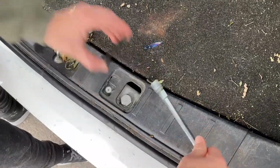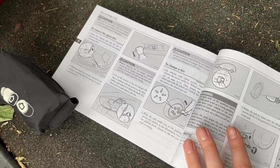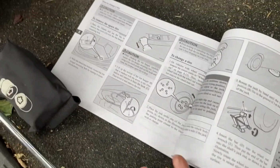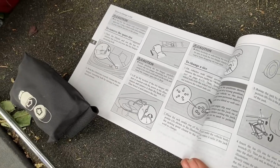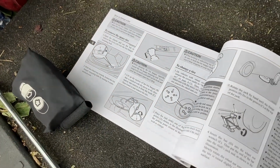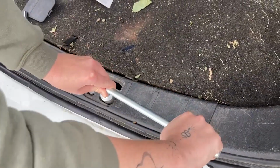Okay. So use that to pry that guy open. Yep, just like that. Nice. Didn't even know that was in there. Okay, and then what does it say to do next? Crank it open. So it says, with the wheel nut wrench, loosen the tire hanger mounting bolt by turning it counterclockwise. Do I use this one? No, the lug nut wrench. Yes. So lefty-loosey. So the other way.